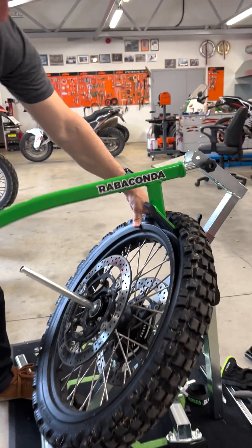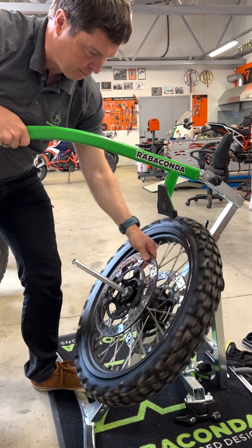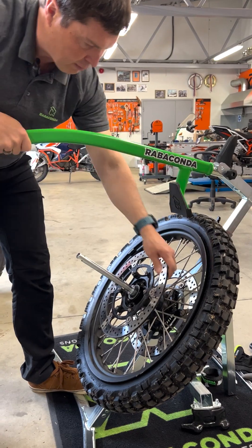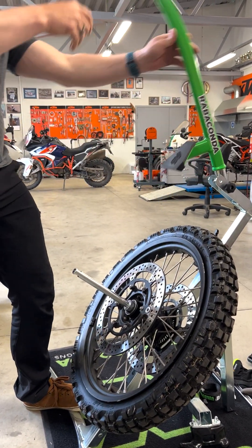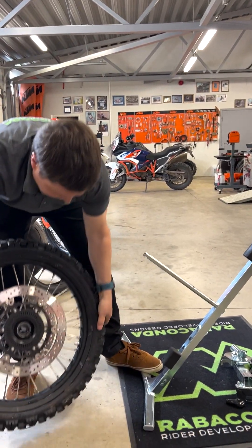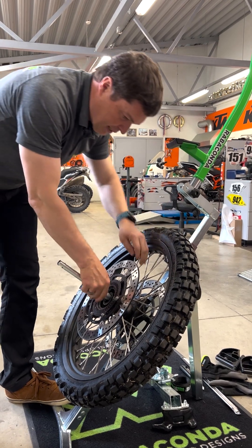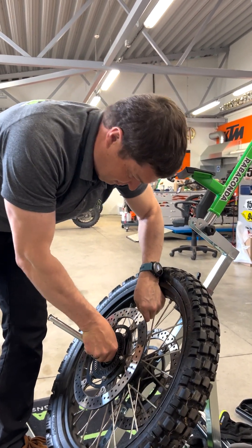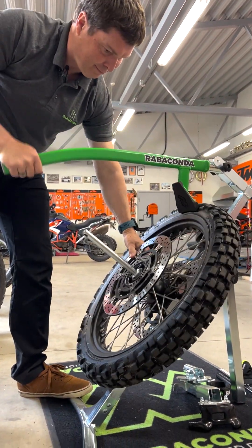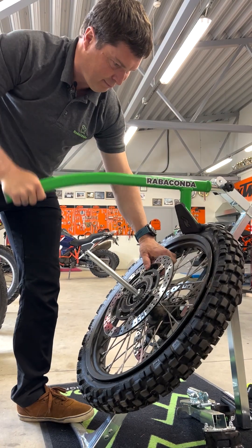Okay, give it a go. As this one had an air tube it's not actually difficult to break the bead, but it has been on some time so it takes a bit. Here we have the valve — we go more easy on it — and done from one side. Check again that the wheel supports are in place and we go for the other side, and here we are.